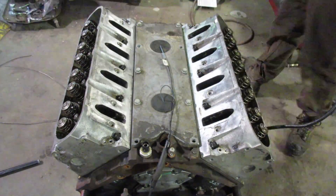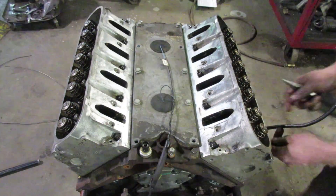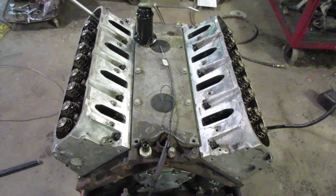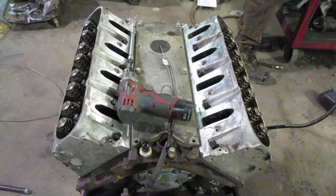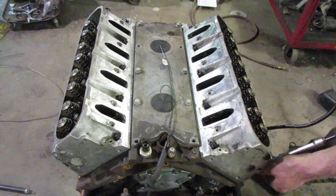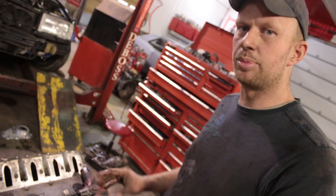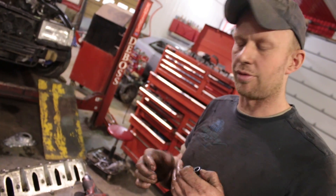That's all there is to tightening the head bolts. I use engine oil on the washers and on the nuts themselves. You don't have to put any oil on the studs that go into the block because they're not turning — all you're doing is stretching the bolts coming out. If you feel like you want to Loctite it, you have to have all your nuts tight before that Loctite dries, otherwise it doesn't stretch that bolt again and you're getting a false reading.